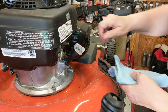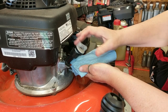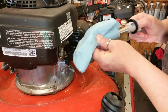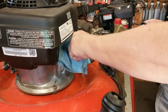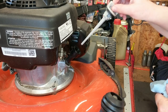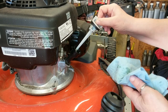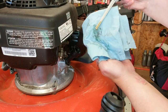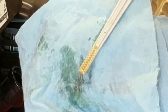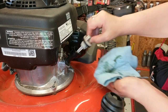First thing we're going to do is check the oil level and see how that looks. She's had it for about four or five years but doesn't use it that often. The oil level looks pretty clean, but we're going to change it anyway. One mistake a lot of people make is they check the oil on a Honda wrong — on a Honda, you only put the dipstick in as far as the cap is; you don't actually screw it in. The oil is right up at the full mark, so someone might have overfilled it just a little bit. We'll double check, but we're going to change it anyway.